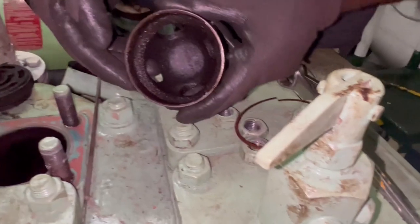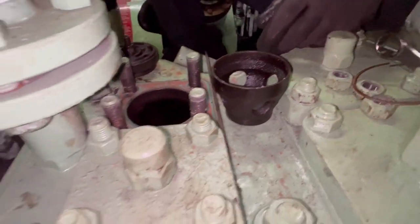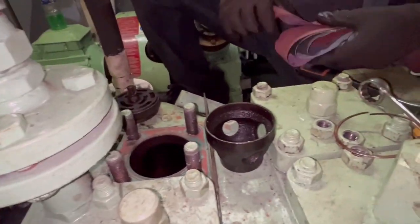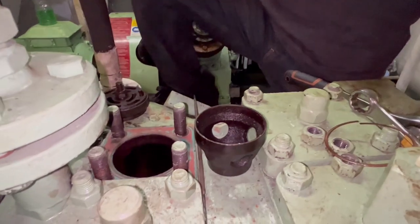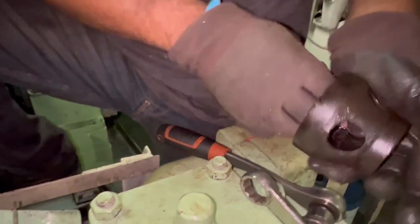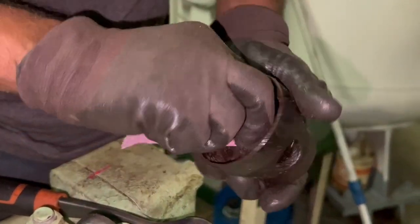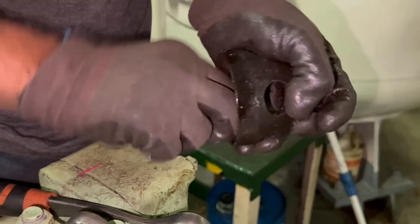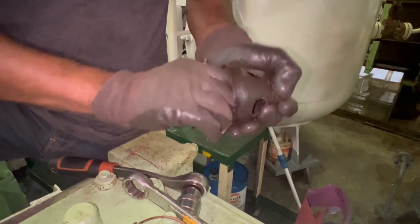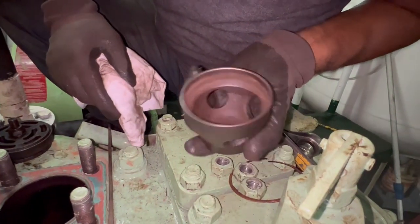You can see the gasket is already damaged and broken, so I cannot use it again even after annealing — I have to discard it. Next, these are the carbon deposits inside the valve cover that need to be removed. You can use a small buffing machine, a pencil grinder, or emery paper to remove all the carbon deposits. Use hard emery and ensure all carbon deposits are completely removed so it looks clean.